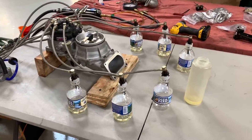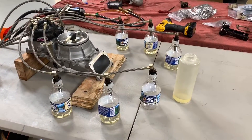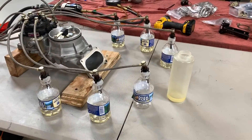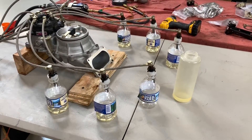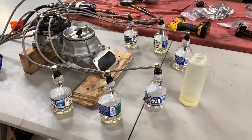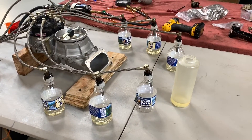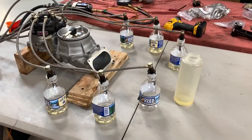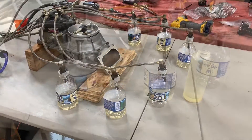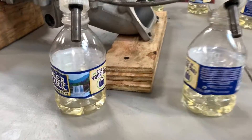The real question is, do I need to replace these poppet injectors? Because anything past 90% tends to start skewing pretty hard. We're looking at an 8 to 10% differential between all the cylinders up to about 90%, but from 90% to full throttle it goes from 20 to almost a 60% difference.